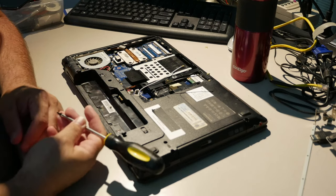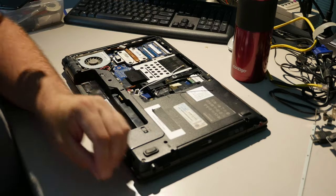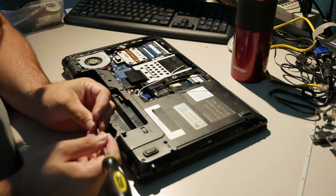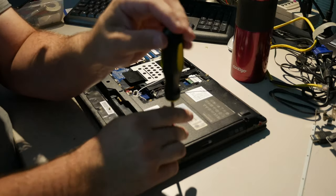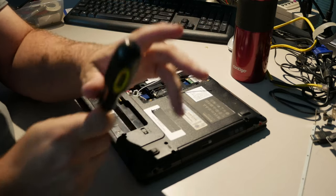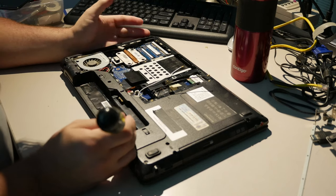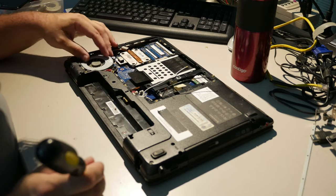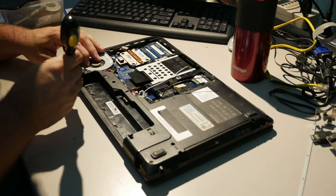They just, you know, the screen is broken off the computer. Well, what we can do is rip the screen off, and back in the day before Wi-Fi, you didn't have Wi-Fi antennas to deal with at all. So that did also make things a little easier. But hey, we can take the top half off and pull the LCD cable out and so on, hook up an external display, and since it will boot with an external display as the primary monitor, we don't have to worry about it. It'll just work. You know, I always like to trademark. Just work, trademark.